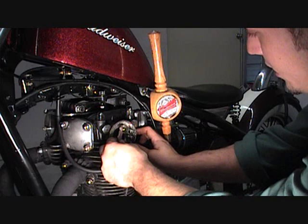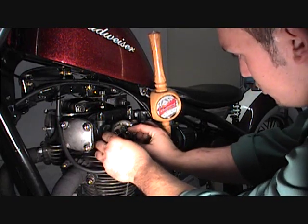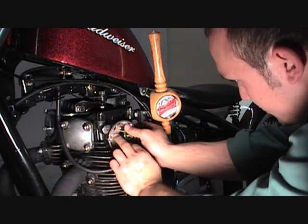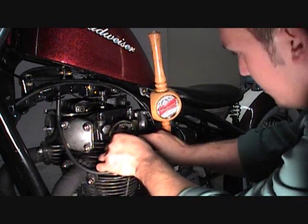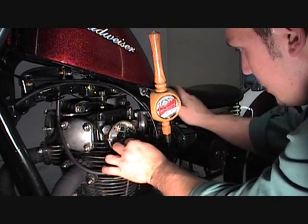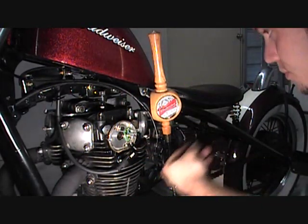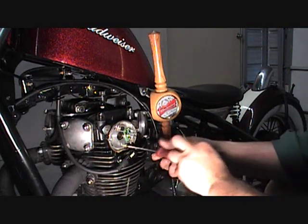That part starts in here — plug the rubber back in it. This part goes up; it's a little tricky if you're not careful how to get it in there. It needs to be turned a certain way. PANCO's got a couple pictures on their site that show how it should look, which should get your bike started. Mine is an 83, so mine's gonna be about right there. You've got two bolts that come with your kit, and washers — you want to put those in. The holes are already there for it.